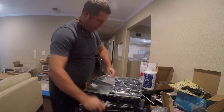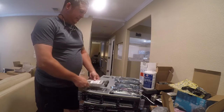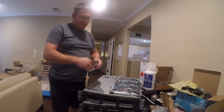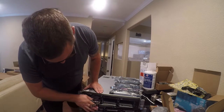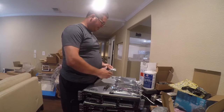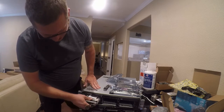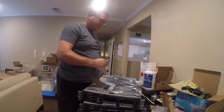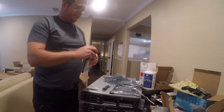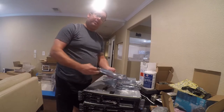There's not really a right or a wrong way on these, so we're just going to go ahead and pop these out. These are three terabyte Hitachi drives. They are used, so there's a little bit of a risk there, but honestly it's okay. We're going to run a diagnostics test on disk. These were pretty reasonable so I'm willing to take that chance. The nice thing is these are enterprise drives — designed for 24/7 utilization. They are SAS 10K drives. They should give me pretty decent performance.